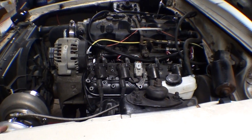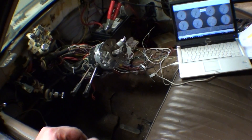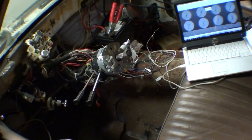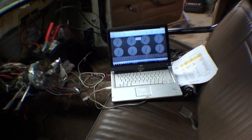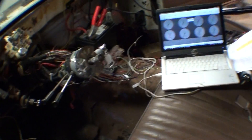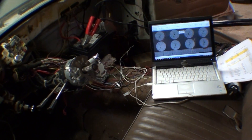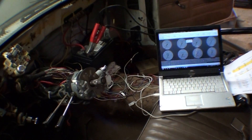I have the ECU turning the fuel pump on and off. A bunch of times when I keyed the car off it kept running and I had to push the ignition to shut it off, so I think my ignition switch might be a little shitty. In the long run I'd like to get a trans brake in this car. I can wire the MS3 Gold Box from EFI Source to the trans brake and it will control it. I can even do an internal bump box — you don't need to buy a bump box, you can bump the car in with the ECU, no extra boxes.